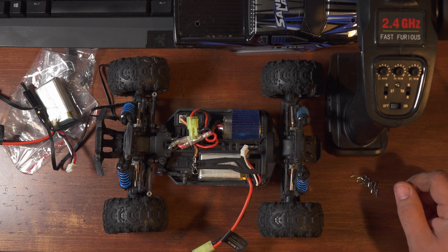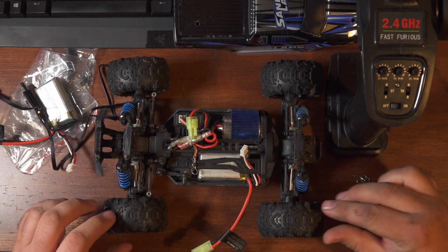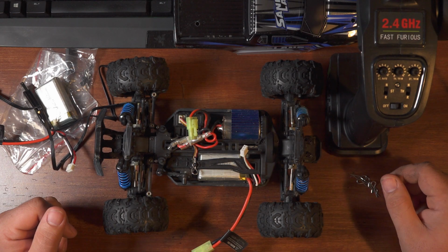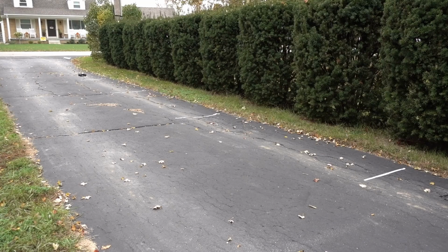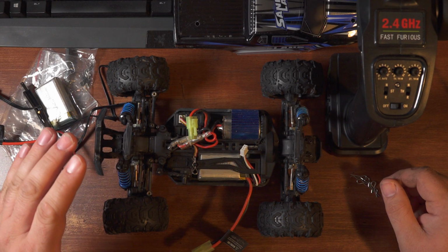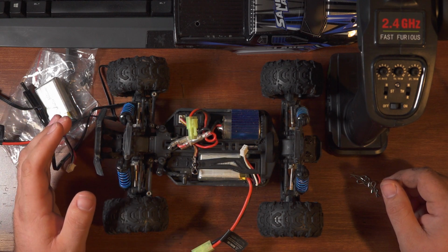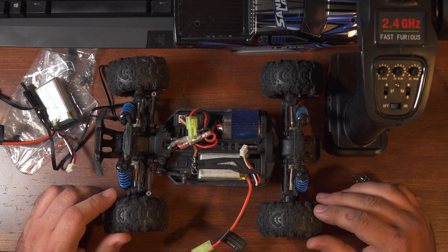I drove the truck a bit prior to speed testing just to break in the motor brushes and hopefully wear in and free up the drivetrain a bit. I tested the top speed on my flat, paved driveway with a fully charged battery fresh off the charger. I put lines on the driveway at exactly 10-foot intervals, and I did multiple runs in both directions using 2 separate cameras, and then I compared and confirmed the results. Using the lines on the pavement and counting the frames in the videos, I calculated a top speed of 12.5 miles per hour, or roughly 20 kilometers per hour.